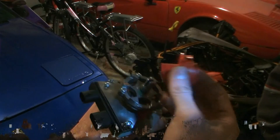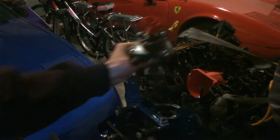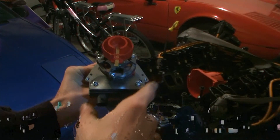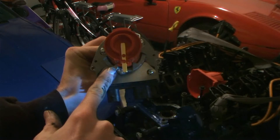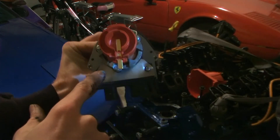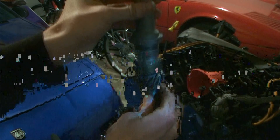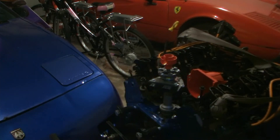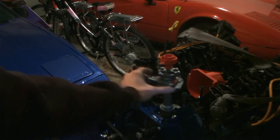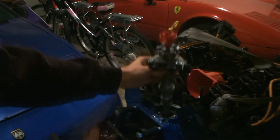We're going to put the rotor on there, then sit it in so that the rotor points to what would be the equivalent of the cylinder number one spark plug wire. On the A1 Cardone, they put a marking to line it up as to what cylinder number one would be. Now when you actually set it in, because of the spiral gearing, when you set it in it's going to spin. So you actually have to move it back a little bit and have it rotate into place. You want it positioned at about a 45 degree angle — you don't want it at a hard 90 either way, because it'll be in the way of the ignition coil, which sits here, or the throttle body, which sits here.